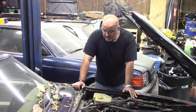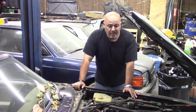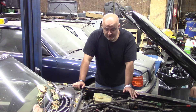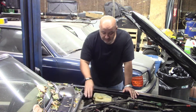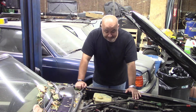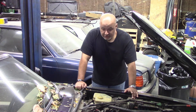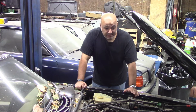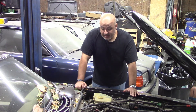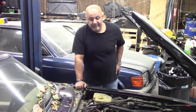I'm not sure exactly what the problem is, but I think only one brake caliper is actually engaging and nothing else is. This system is a little bit unusual — it doesn't have a brake booster, or a servo as they call them back in England. Instead, what it has is an ABS pump, and basically the pump builds up pressure and activates the rear brakes and also provides the vacuum assistance effectively.